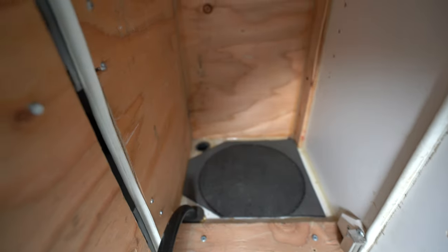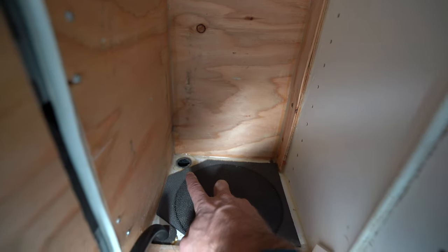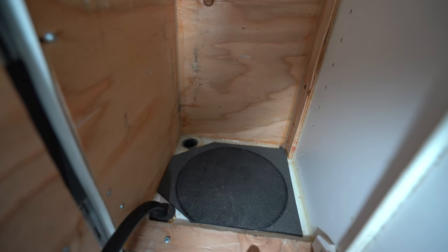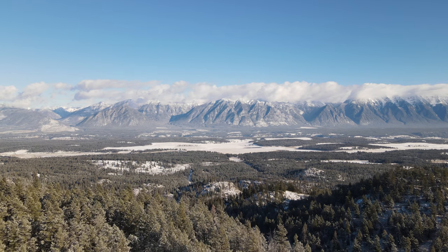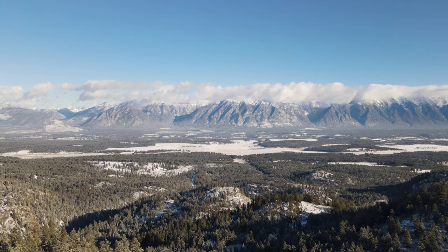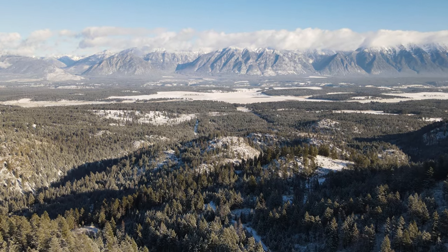In the back of the cabinet there is the vent, which is a three-quarter inch pipe — larger than I needed to install, but I wanted to be sure. It is sealed with a sealant around the outside and goes straight out to the bottom of the van. The most important reason you need a vented cabinet is because when you're changing elevations, like driving into the mountains, your propane is going to expand inside the tank and it needs to be able to vent. I would recommend a three-quarter inch pipe out the bottom of your tank going straight down outside your van.